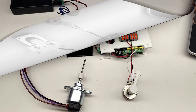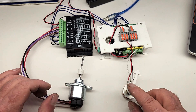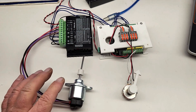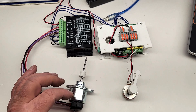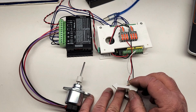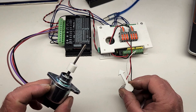Let's take another look at this stuff, but this time we'll use our repurposed idle air controller motor. I'll turn the power on and you can see the motor retract to find home position and then go to the position that the potentiometer wants it to go to. Not too shabby. I have all this stuff slowed down so it's easier to see, but I can change a few variables in the code and it will be a lot faster. If I change the position of the potentiometer, you can see the fuel rack limiter thingy moves in and out.